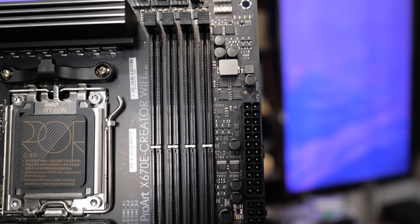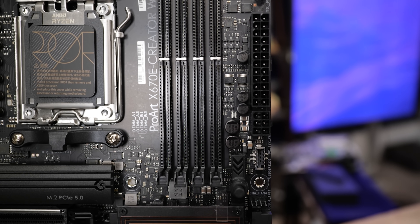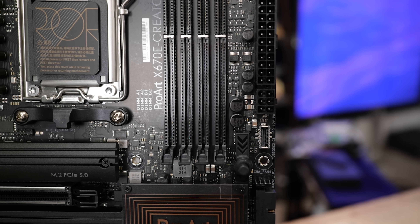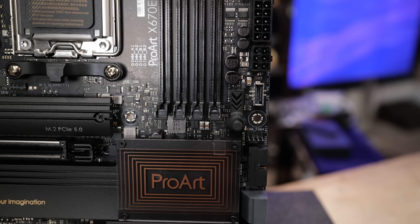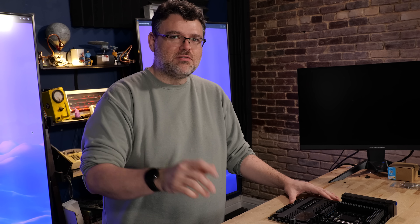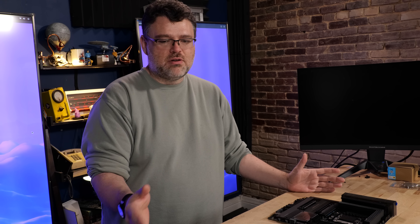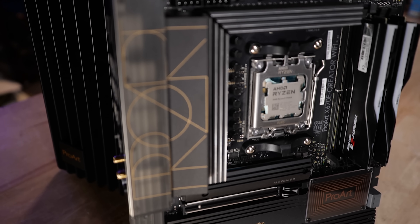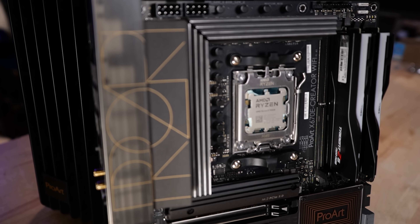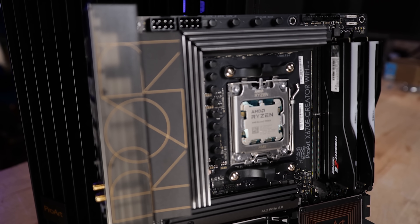The manual says this board doesn't do unbuffered error-correcting DIMMs, but as we'll see in the Linux testing, it does report that it's doing ECC and I can inject errors — which is surprising, but difficult to fully verify. We got into similar trouble on AM4 where ECC was working but wouldn't necessarily report errors in all circumstances. AM5 seems like a slightly worse situation, but the functionality for injecting errors is exposed on the platform, which is nice.